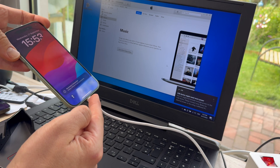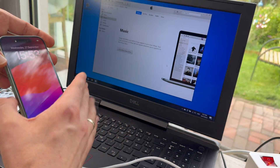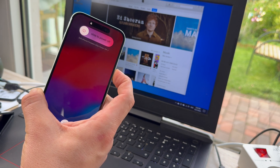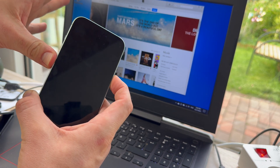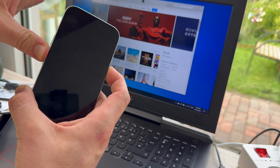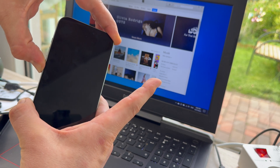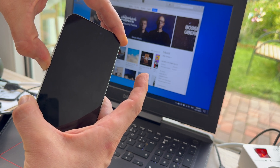Okay, let's perform this. We enter the device using the USB-C connection to our computer, then press volume up, volume down, power button — keep pushing until the screen goes black, approximately 10 seconds. Then release and press the power button and volume down button together for approximately five seconds. After the five seconds, remove fingers from the right side, and now keep holding the volume down button on the left side.